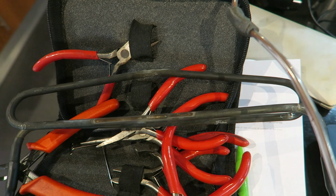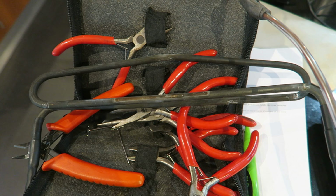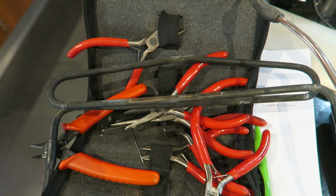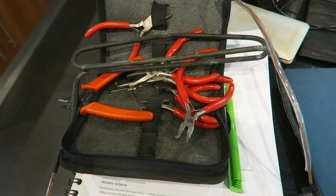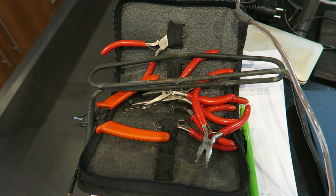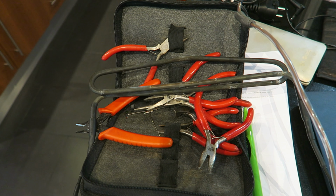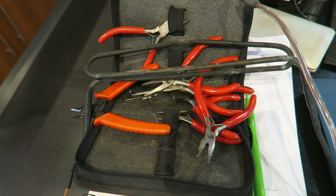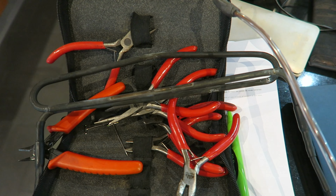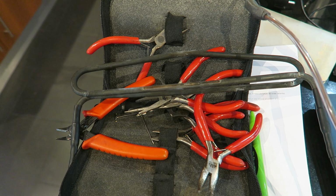I hope this helps someone to fix their fridges. And your fault may be different, but from what I read in the forums, this is a pretty common problem. The fridge did have a problem. The fan on the back was making a tun tun tun tun noise all the time. And after I dismantled the fridge, I realized it was the fan eating the ice, because obviously the heating element was not defrosting the evaporator.